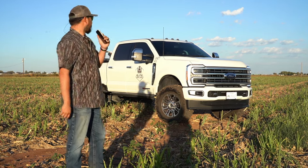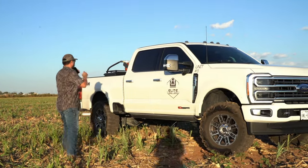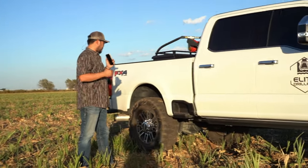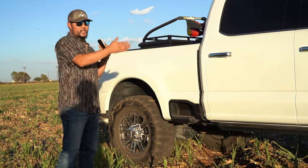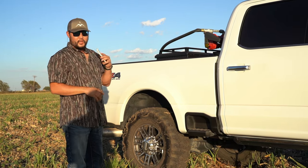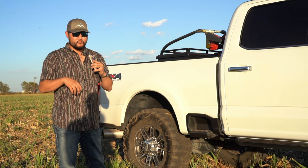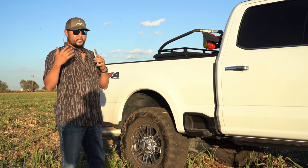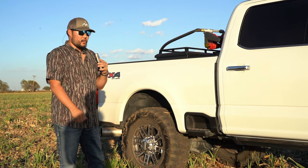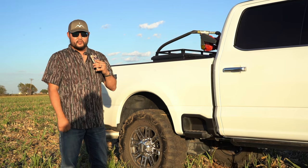We're going to do a little walk around and go to the toolbox and fuel tank setup. A big question I get is: how are you able to run a gooseneck hitch and use it to pull a trailer if you have a crew cab short bed with a toolbox and fuel tank? What I use is an offset hitch. There are three different companies I use: Gen-Y, Curt, and B&W. Depending on what kind of gooseneck hitch you've got will correlate to which one's best for your application. I've used all three and they work great — I can pull all my gooseneck trailers and my fifth wheel camper with any of these offset setups.